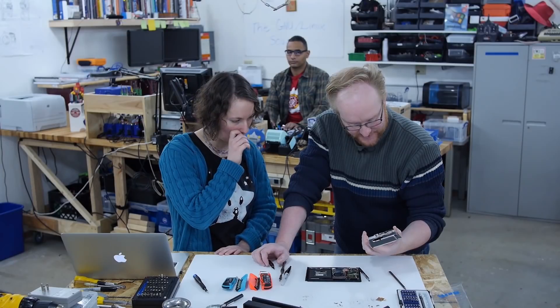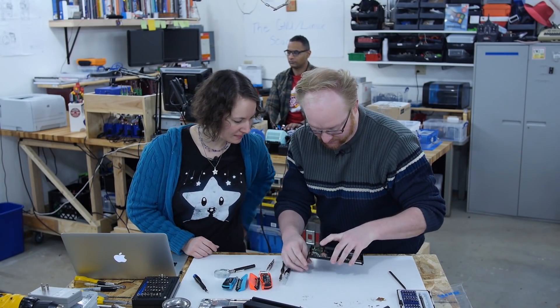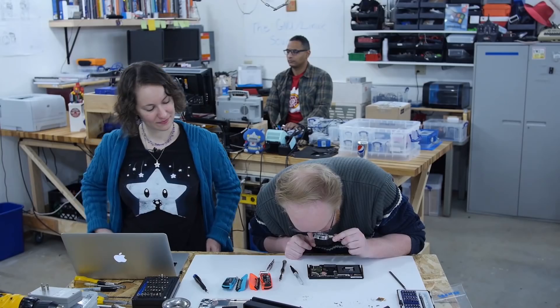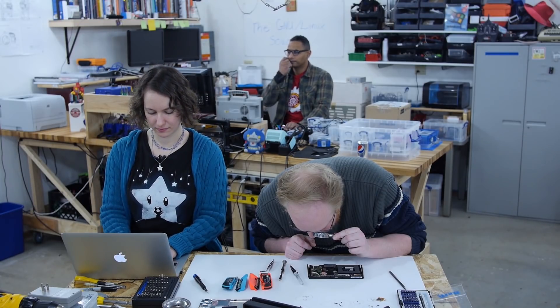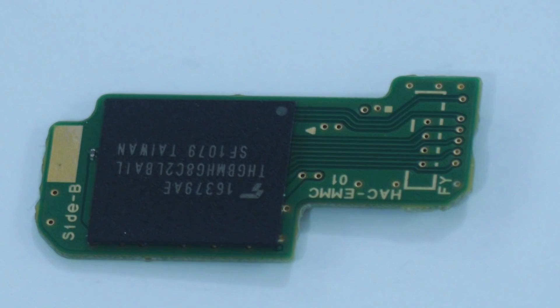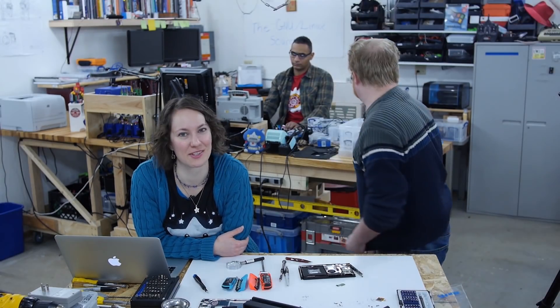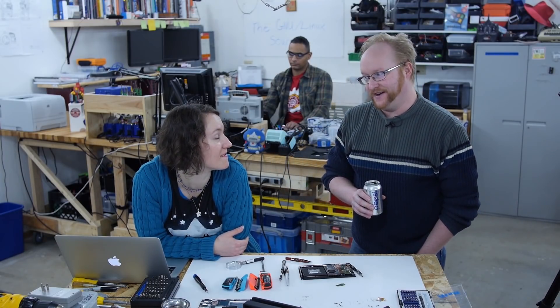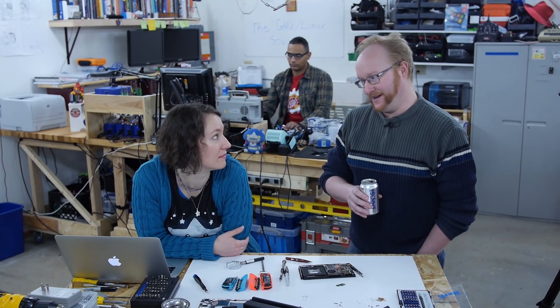Thermal paste — they were dissipating heat into the case. Interesting — it's on a separate board, like it's meant to be upgradable. That's probably RAM. Part number THGBMHG8C2LBAIL — flash memory. They could put more memory in the system just by changing that part. The fact that they made this a removable part and spent money on two connectors really tells you something — they have plans. Expect to see a Switch with more memory very soon. The formatted size is about 25 gigabytes and Zelda is about 14 gigs, so without a cartridge the internal memory would only hold one full-size game.